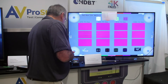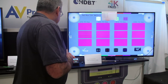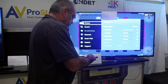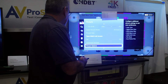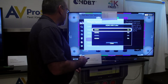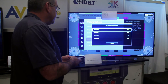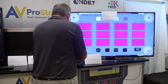So this is the process we'll go through on each one of these ports to determine what works best in which port. The other thing I'll mention with this display: you do have to change a couple of things in the menu to get it to do expanded colors. Right in here you've got HDMI UHD Color — you do have to make sure this gets turned on if you want to have any chance of using expanded colors or the full 444 UHD 50p/60p 444. Alright, so that's port 1.